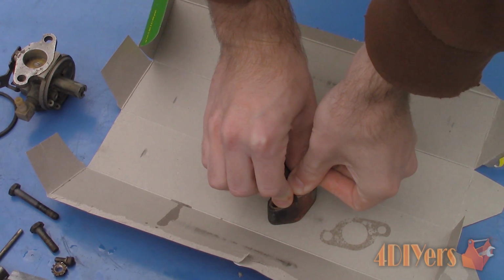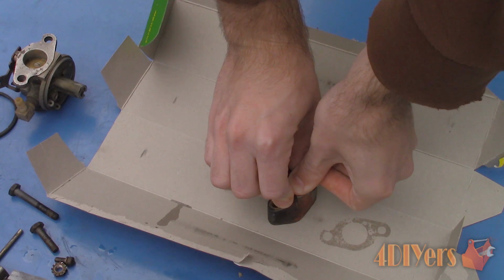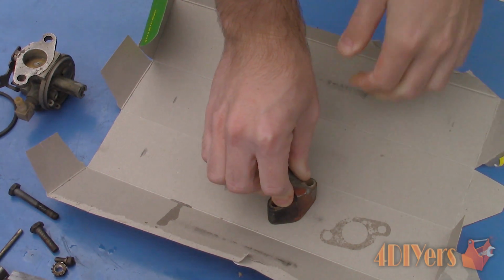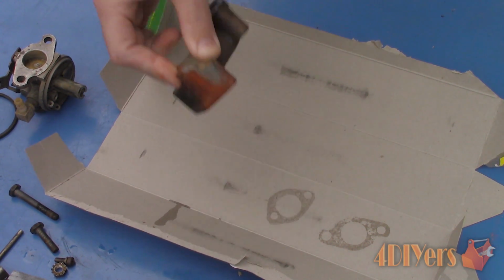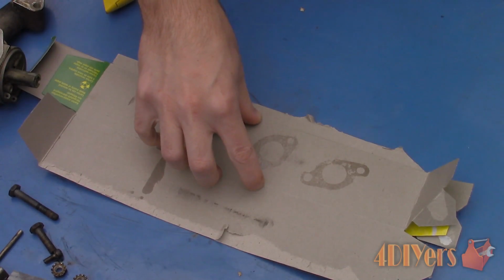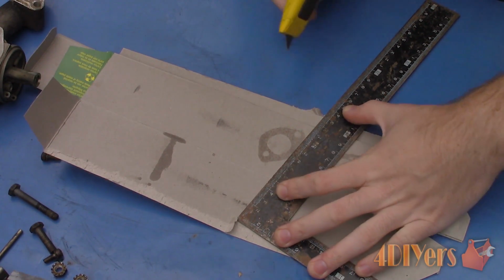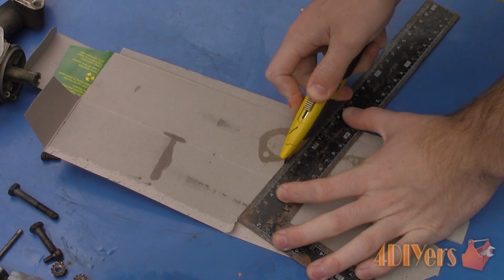First, apply a small amount of oil with your finger on the surface we are copying. Here I'll be using an intake manifold. Now stamp the surface onto the cardboard, typically on the inside face of the cardboard where there is no shiny printed surface as it transfers better. Leave it there for a moment, apply medium pressure, then remove. Now you can see there's an outline of the surface. If you let it sit for a moment longer, the oil will soak into the material a little more, allowing the outline to be a little darker and easier to see.